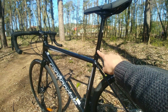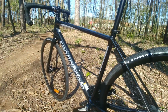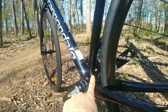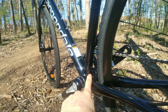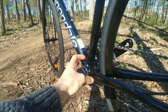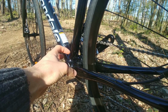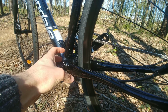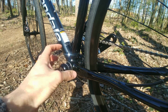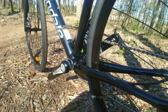So this is great. Then we have this seat tube, which I'm gonna show you here, called the Delta seat tube, but the Delta system is not made for micro suspension. It's made for the stiffness of the bottom bracket shell, because this is the area which you don't want to flex. You want this part to transfer the power from your legs to the rear wheel. So this Delta seat tube has to be really stiff. That's why it's going wider and wider towards the bottom bracket.